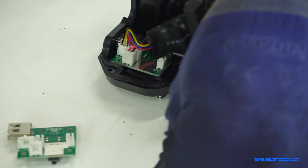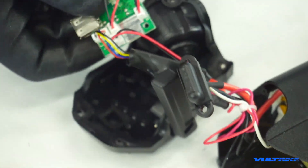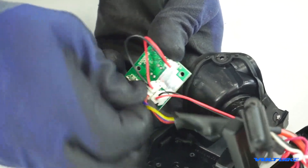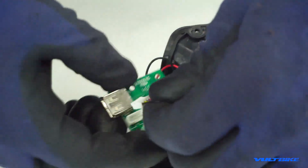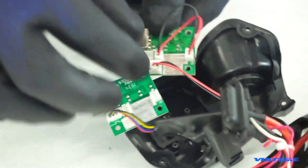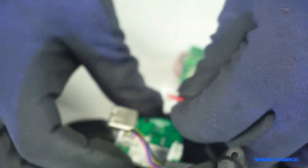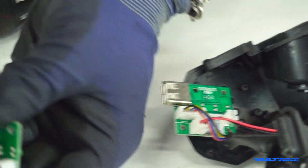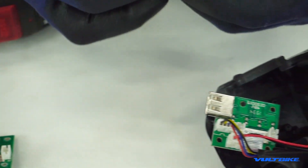I usually like to extract the screws first before I pop out the panel — that gives me a little better reach to the connections. This can be a little stiff to remove occasionally, so just be persistent and patient; it just takes a slight wiggle. If you're confused about the orientation, unplug one and plug it into the next — it's fairly foolproof. Just a short wiggle, patience and persistence; you don't want to break these wires, they are fairly thin gauge. The two that connect to themselves just need a slight wiggle and they come out no problem.